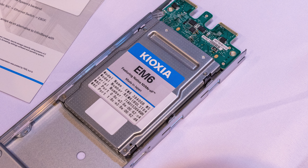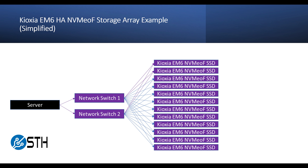The reason that those EM6 SSDs are so much different from pretty much anything else you've seen is really just the fact that they are different. They actually speak — instead of NVMe — their external connectivity is actually 25 gigabit Ethernet. So when you plug that SSD into a chassis to get power and cooling, instead of it going over PCIe a bunch of times into CPUs, it directly goes into a network switch.